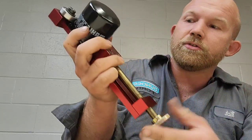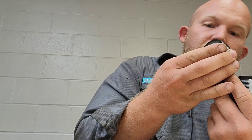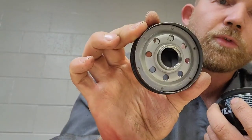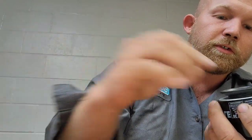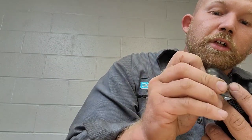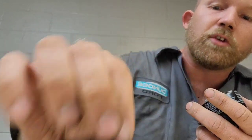That's a nice can. When they cut open that quickly and don't fight you, typically it's a decent can design. Pretty strong can. Looks like I've got four full threads in here, so that's pretty impressive. The actual thread part is pretty thick overall, and it's got some nice weight to it for a small filter. It's a rubber anti-drain back valve — pretty nice, pretty strong, nice spring back to it. Very thick, actually — a very strong rubber anti-drain back valve.